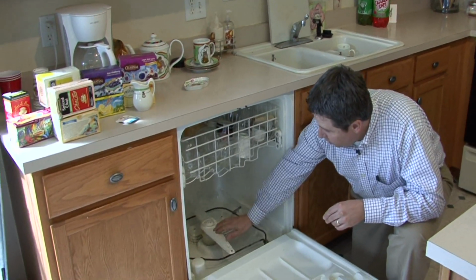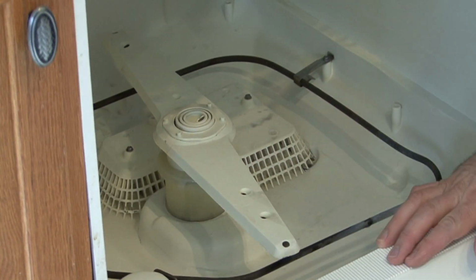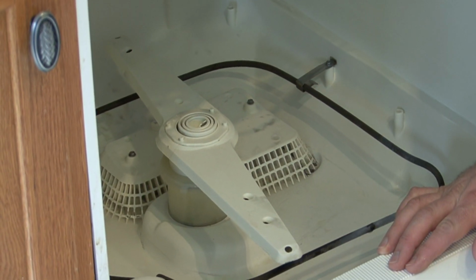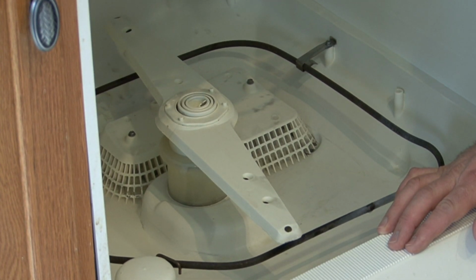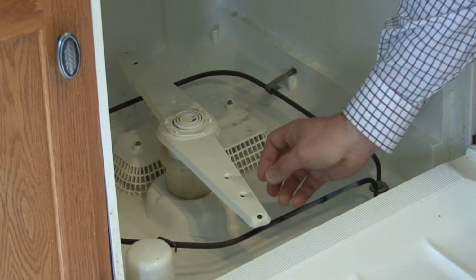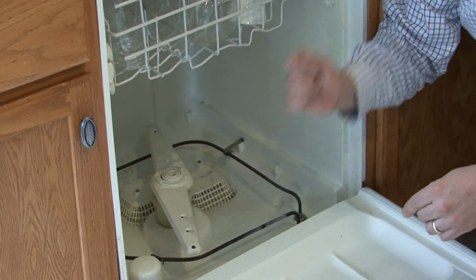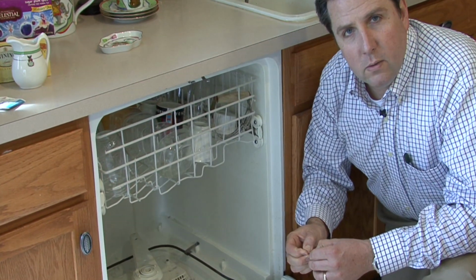It's got spray holes where water sprays in all different directions. And sometimes if you put a mayonnaise jar, a peanut butter jar that has a label on it, something of that sort, the heat, the steam, the soap wash the label off, but all that paper and gum goes somewhere, and it usually gets trapped in these small holes.